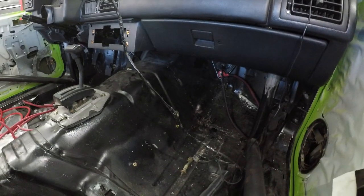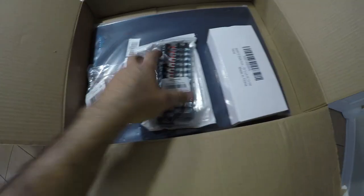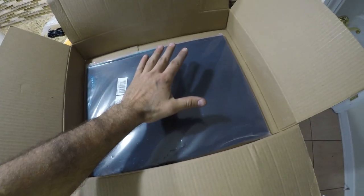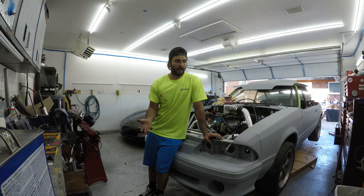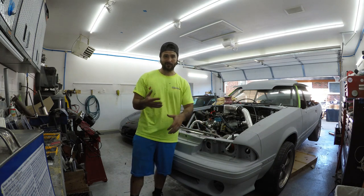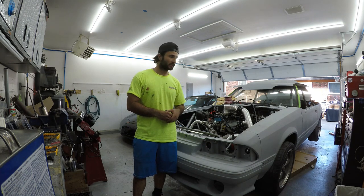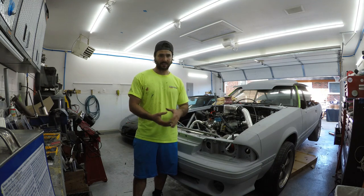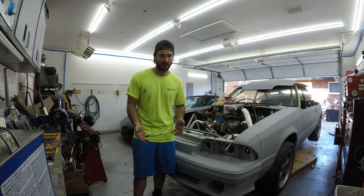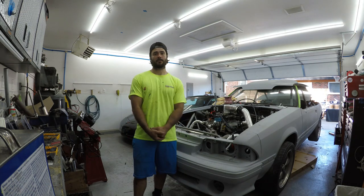All I have left to do is run another one gauge wire from the back up to here to power my fuse and relay panel — that'll be in the next video. I've got some bus bars, some lugs, and a piece of quarter-inch thick ABS plastic sheet that'll be mounted up underneath the passenger side. All the positive and negative main wiring is redone. Next I'll wire up my fuse panel and a switchboard to run everything off switches — the fans and everything — and then hopefully the car will be basically 100% wired. If you're not subscribed, hit that subscribe button so you can see part two. Thanks for watching!